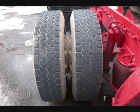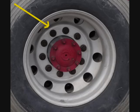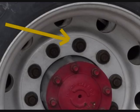Check the tires for tread, pressure, and condition (TPC). The rear tires should have at least two thirty-second inch tread, evenly worn. Air pressure should be checked to meet the tire manufacturer's specs with a tire pressure gauge. There should be no cuts or other damage to tread or sidewalls. Check the space between the tires to make sure they are not touching and that there is no debris lodged between them. Each tire should have a metal valve stem and cap that is not missing, broken, or damaged. Check the inside and outside of the rim, ensuring no cracks, bends, or weld repairs. Check the lug nuts to ensure they are all present, free of cracks and distortions, and show no signs of looseness such as rust trails or shiny threads. Rust around the lug nuts indicates loose nuts; shiny threads on the studs indicate cross-threaded lug nuts.